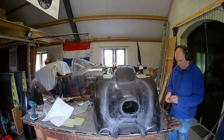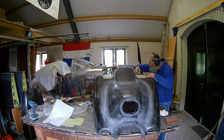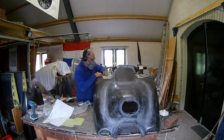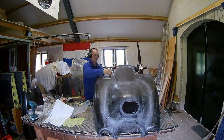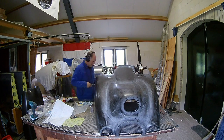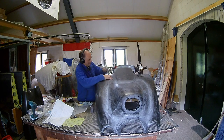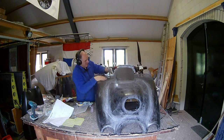So there's probably going to be a pressure build-up in the cowl, or under the cowl. One of the solutions for that is making more exits. Since I already ordered cowl louvers — which is an option, and they're not that expensive — I put them in the kit so if I need them I can just get them. I figured I need them, and I need to install them to increase the amount of outflowing air, so I don't get any pressure build-up, which would also hamper the cooling of the cylinders.